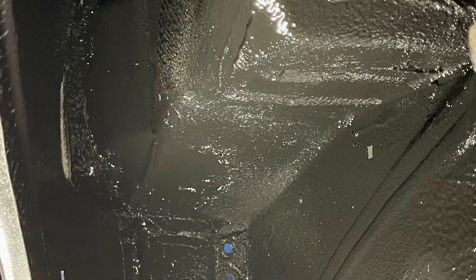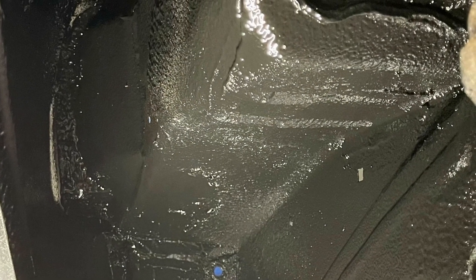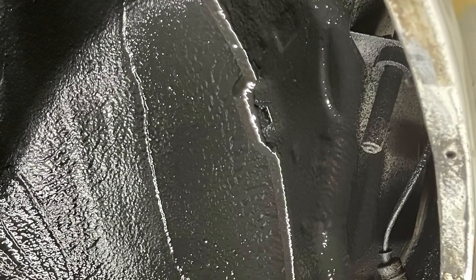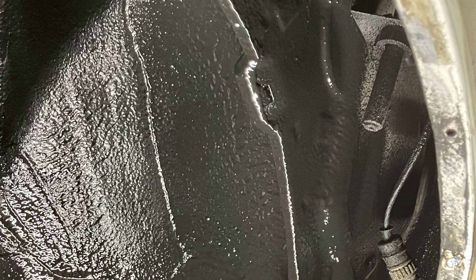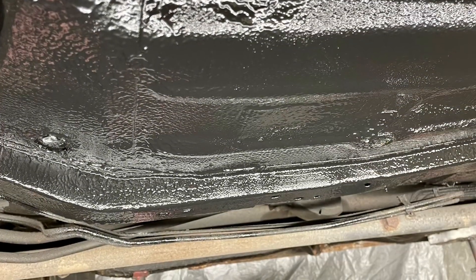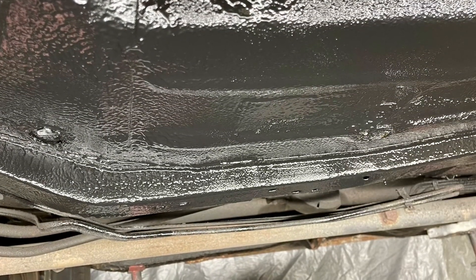Finally I got to stone chip all the front again after cleaning it off and applying red oxide primer, which helps with the protection because I plan to use this vehicle quite a lot and I want it properly weatherproofed. The next stage was to stone chip the floor pan and the chassis, and as you can see the repairs almost look invisible, which is what I wanted.